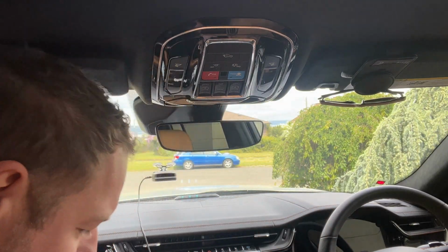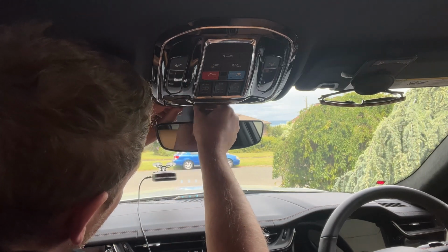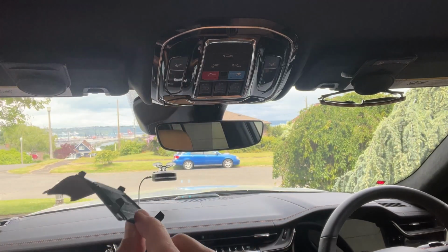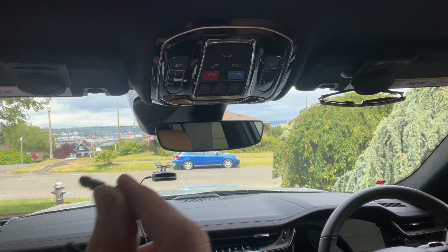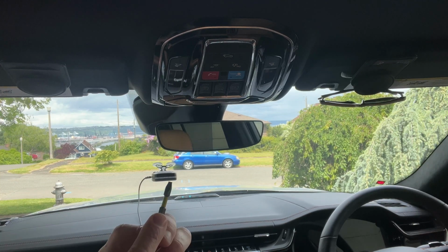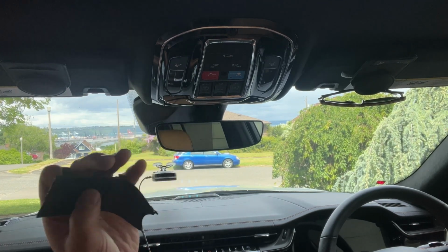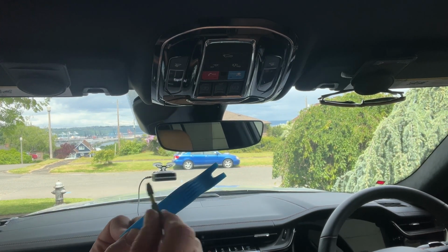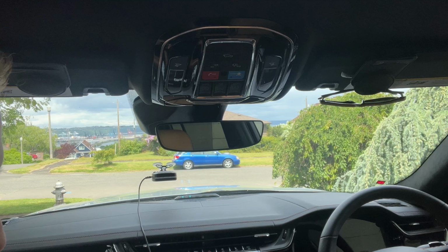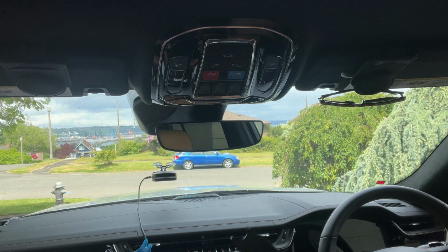Before we even do that though, I should have used my little tool, come in here and just pry open the face cover. Okay, so again, this one is going to make it the easiest. It's a little tiny flathead with just maybe 2 inches of length. The reason I chose this one is because during my Ram install, getting this faceplate off was a pain, especially trying to do it with a blue trim remover tool, because it was just too long and couldn't fit in that crevice. So I've got the hard part off now. Boom, boom. And I've got the face cover off.